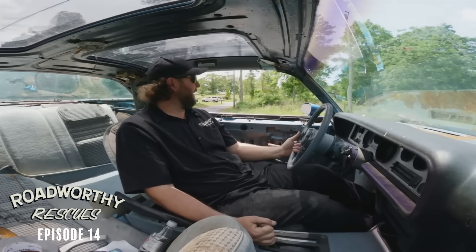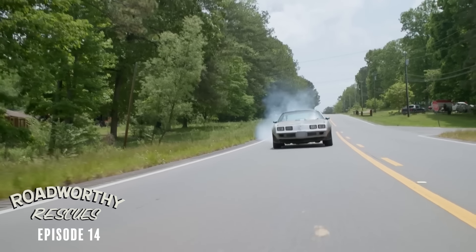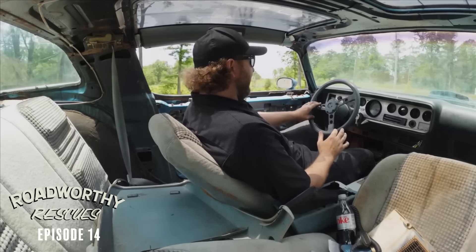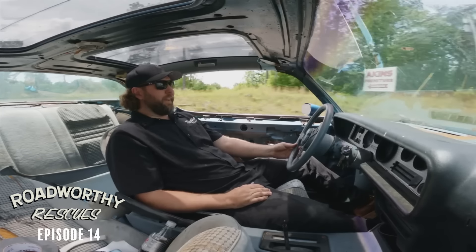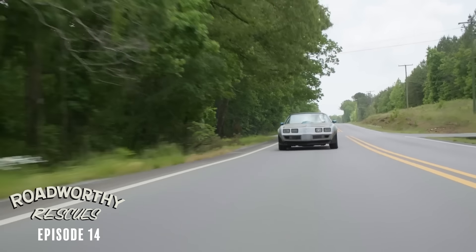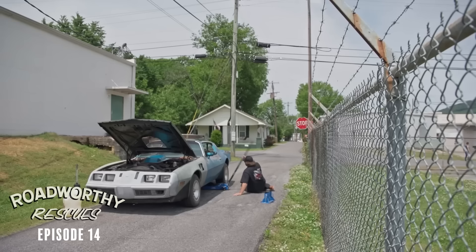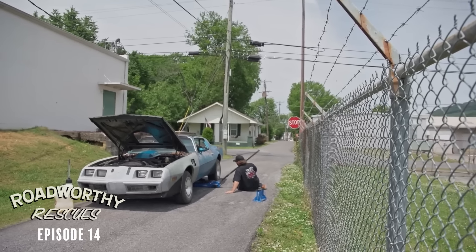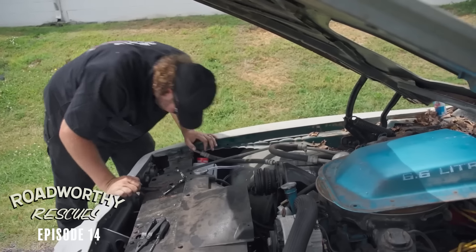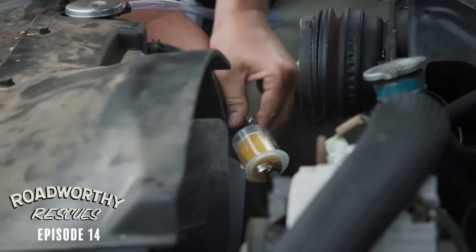Keep your foot hard on the pedal, never mind the brakes. I've never driven a Trans Am from the back seat before — it's a much different experience. These brakes need a lot of work. At least we're not going down 70,000 million feet. The guy's posted up behind a parts store here. I got some things I need to address before we hit the road — B: that tire needs fixed. Number four: it's already overheating. And A: I'm not getting fuel from the fuel tank. It's going to be a pickup screen that's plugged, or the pickup screen or tube is just rotted or missing.